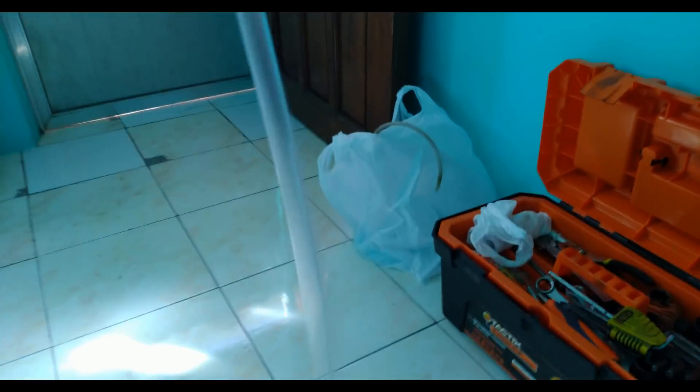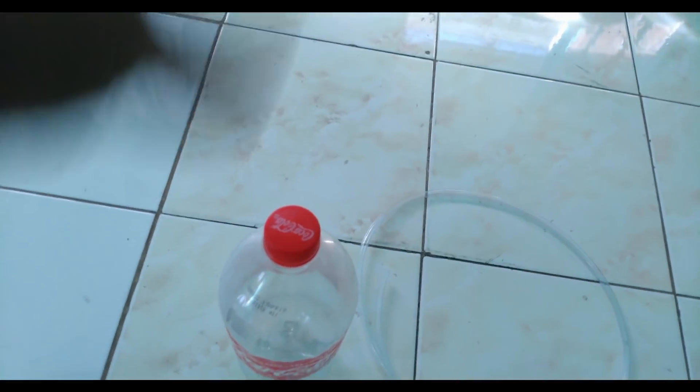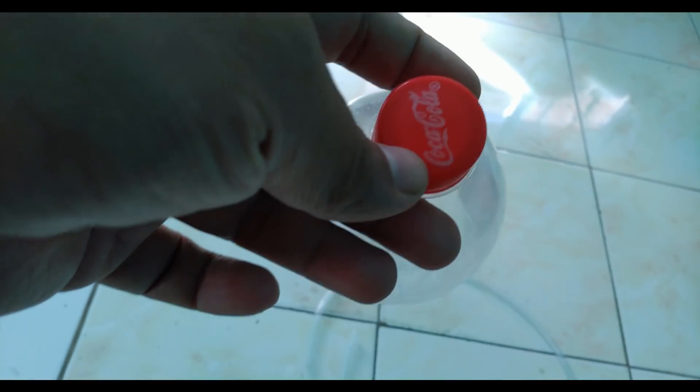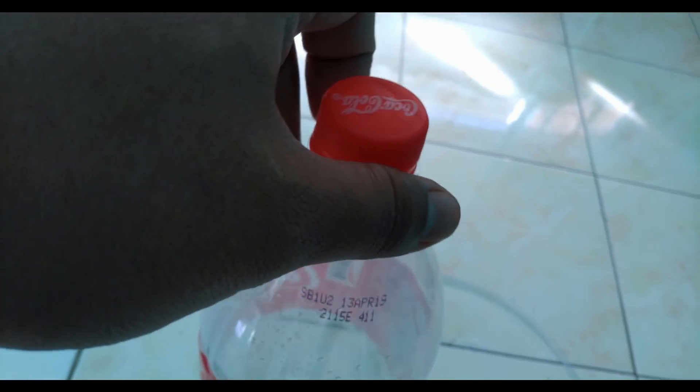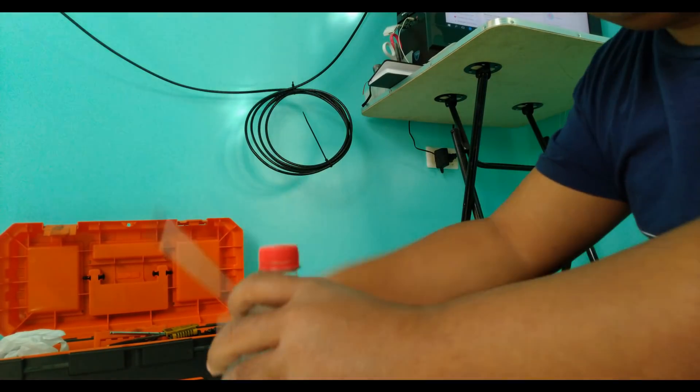This is very straightforward. If you're gonna create a suction bottle, you just need to create one hole in the middle — just enough to make the hose a snug fit inside. But if you're gonna do a vacuum bottle for brake bleeding, you need one hole for the hose and a really small hole for air to escape as an outlet.